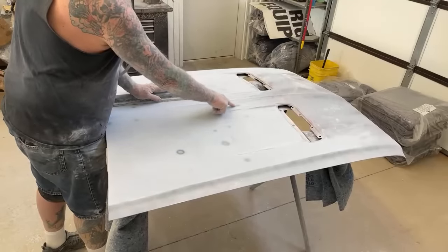What we're going to do: this is a piece of 36 grit sandpaper and I am going to scuff my surface up until the guide coat is gone. I'm going to override the dent itself - approximately two inches from where the original dent is, I'm going to repeat this process. I am using my hand on this - I tell you not to hand sand, but this is not a finished product. We are using our hand to get this surface very rough.